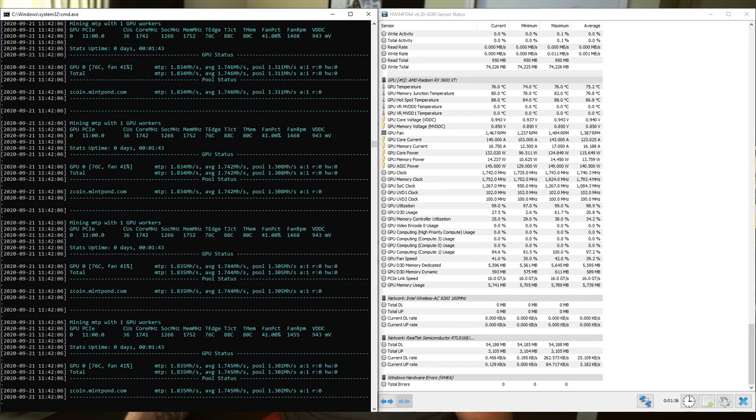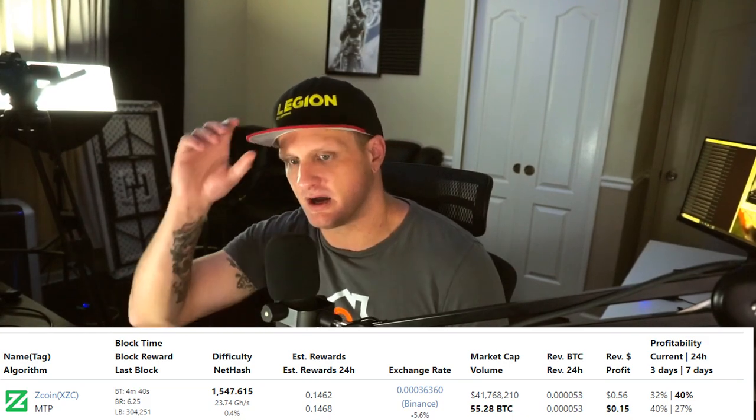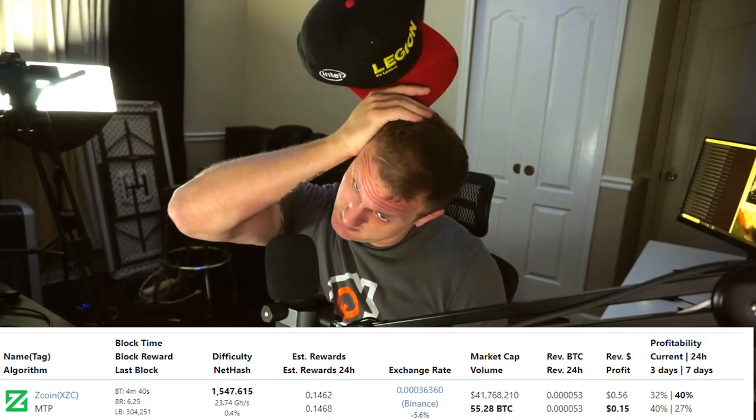Okie dokie. So a more fun one, we have Zcoin here. Zcoin's always favored NVIDIA, just a heads up on that. But on this particular card, we were getting about 1.7 to 1.8 mega hash a second, which is pretty good. And of course, we did mess with the overclocking just like we did with all the other algorithms. And we are around 160 watts exactly. So with that, you do still come out with profit at 15 cents after power on the average price for the USA, and a revenue of 56 cents. The estimated reward is 0.14 Zcoin per day. That's the MTP algorithm for anybody that needed clarification on that.